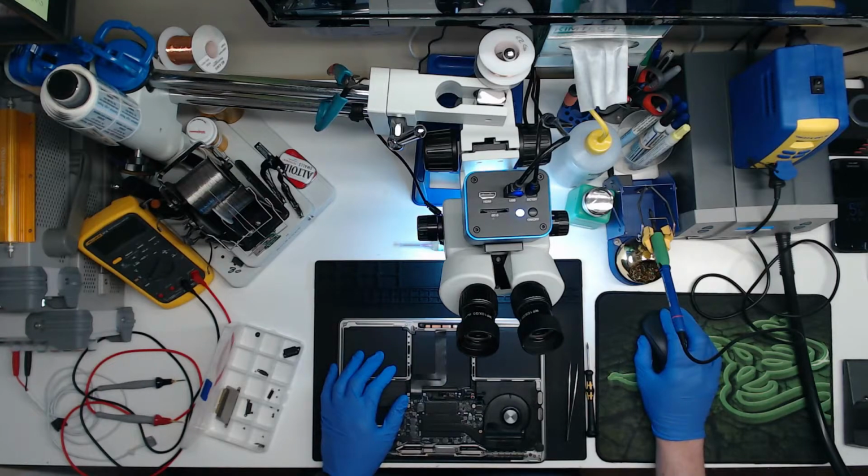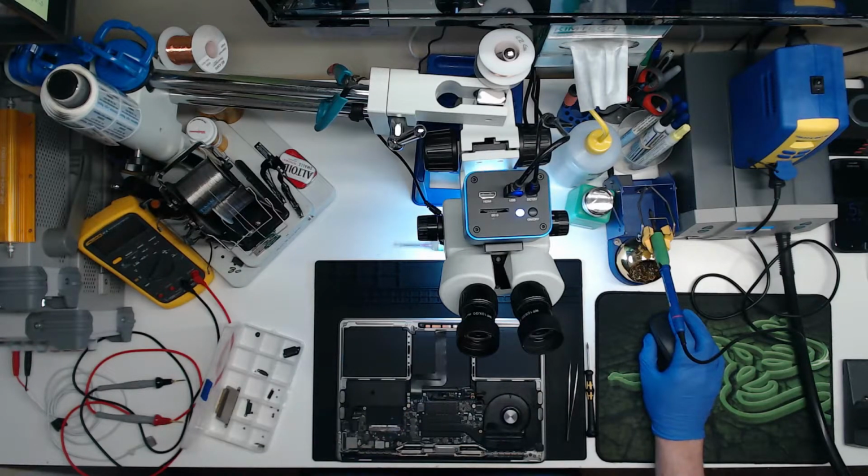Creates PP bus. Not. Where does PP3V3_G3H come from? We have a PM enable, PP3V3_G3H. Yeah, power management enable P3V3_G3H. So it's not PP3V3, it's PP3V3_G3H. U1900? Is that what creates it? No. Anyway, we'll figure it out.